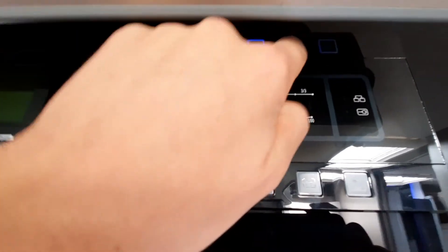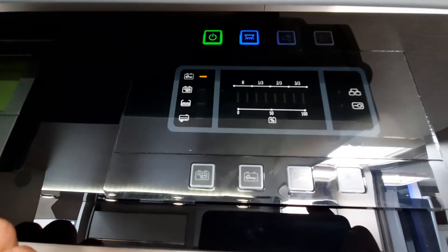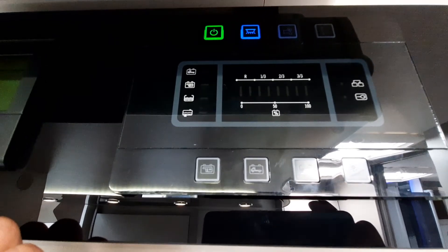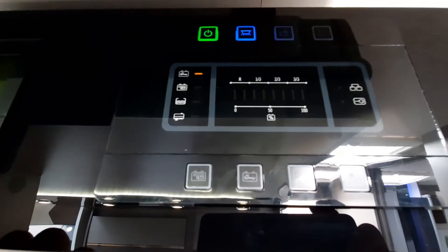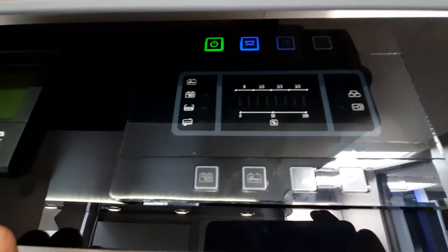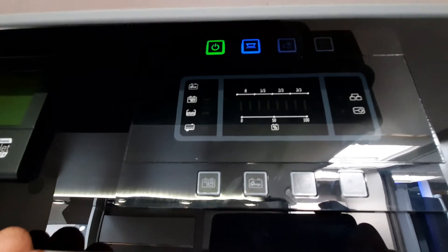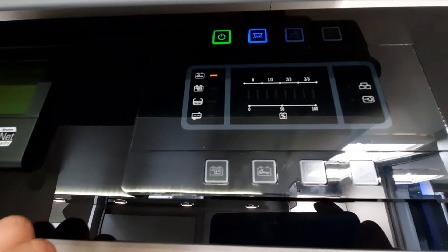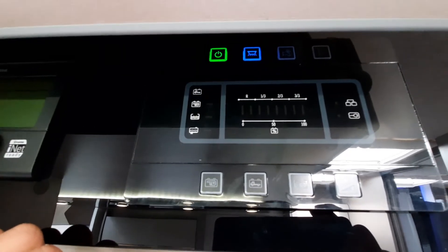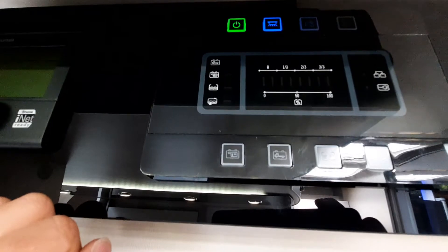Moving across you've then got your pump, which activates the pump. Make sure the pump is always turned off if you haven't got any water in the vehicle — only run the pump if you've got water in the van, because you'll simply burn it out. When on site and filled up with water, turn your pump on and go to all your taps. Turn your taps on and turn them to hot. That pulls water from the fresh water tank, through the boiler system, and out of the tap — and what we're doing here is priming your system. Initially it's going to spurt and splutter, but when it's running steadily, your system is primed.